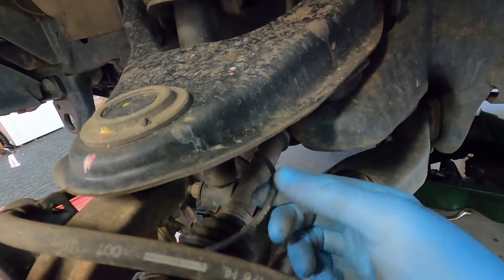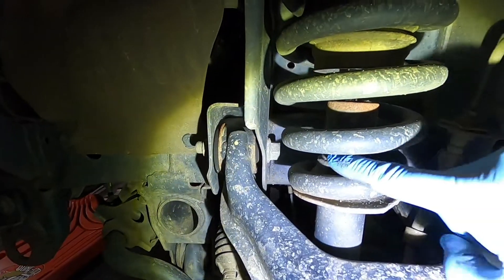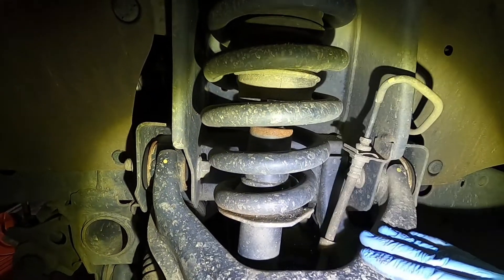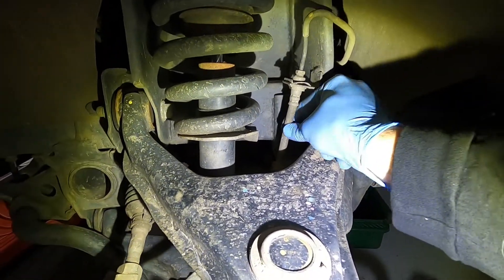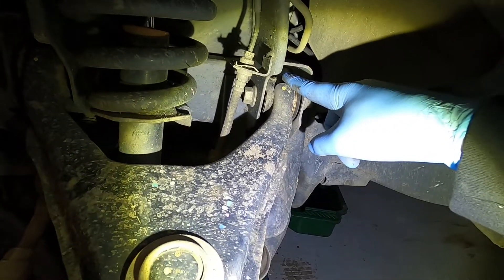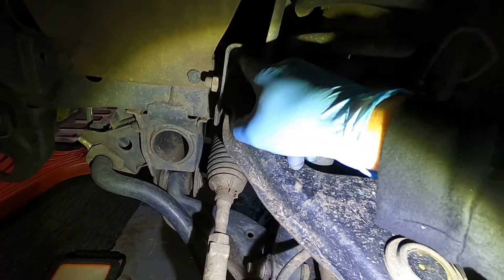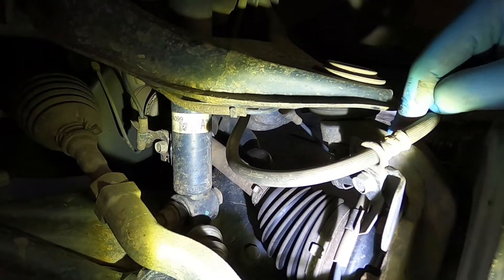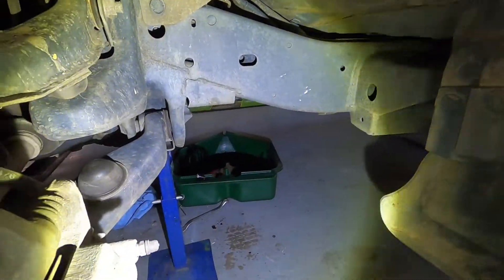This is your ABS sensor line - you don't need to check that. While you're under here, look at your shocks and make sure there's no oil or oil residue around the shock absorber area. Check all your brake lines. Your bushes - you'll actually feel if they're worn. Get a bar in there if you have a knocking in the front end, lever it up and down, and if you get movement in those two bushes they need to be replaced. Same with your ball joint - I'll show you when I put the wheel back on how to check for wear.